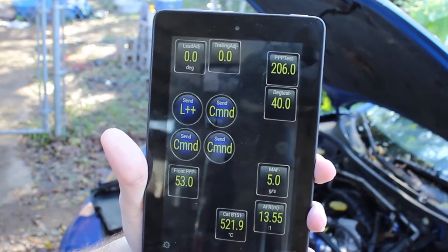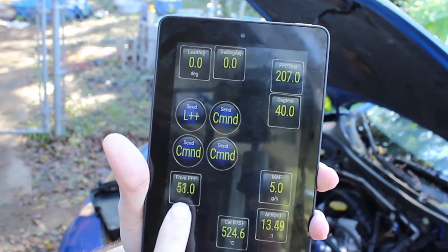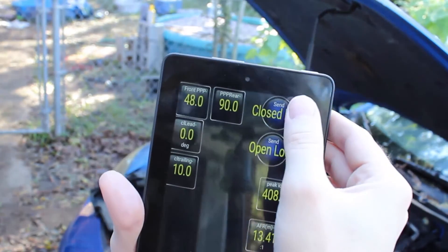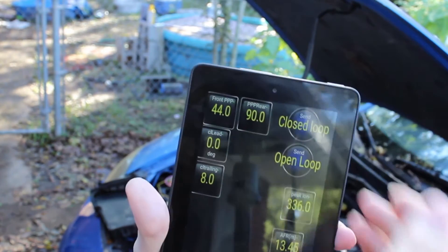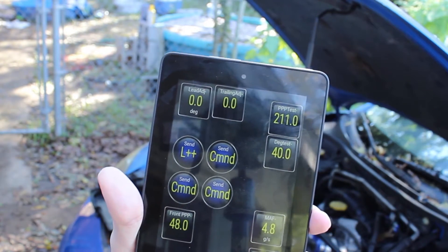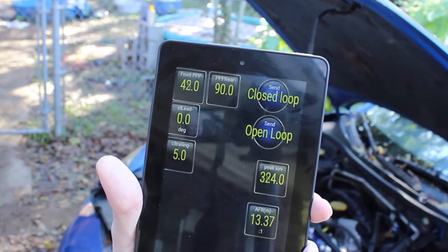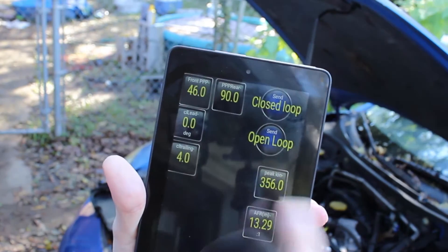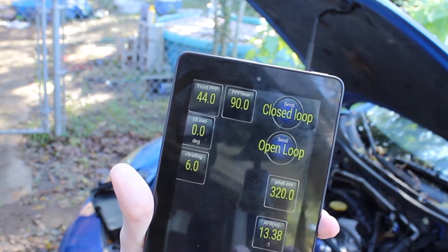Alright, the engine's running and the peak pressure point is about 50 to 55 degrees. Now I turn on closed loop — it already has a 10 degree demand — and it drives my peak pressure point right to about 45 degrees and then it hovers around there. Because of the differences between cycles, it's not going to ever be perfectly at 45 degrees and stable. But it works.